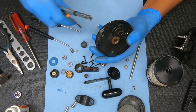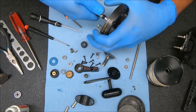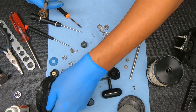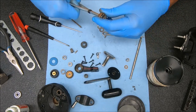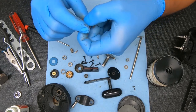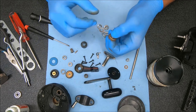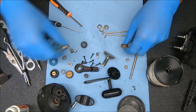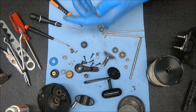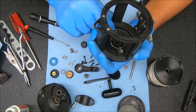This may or may not be easy, but we're going to find out right now. Oh, that was pretty easy — I honestly expected it to be frozen. So now here's a great example of how something still works when you pull it out, but we know it's bad because of the test we did earlier. I'm obviously replacing this. The two things I'm replacing so far: this bearing and the pinion bearing, and I'm flipping the drag washer.